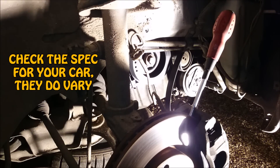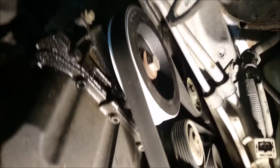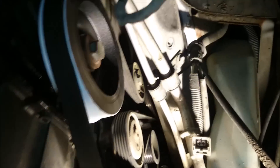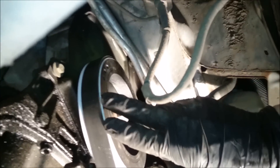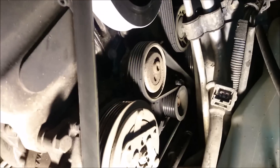All we need to do now is replace the belt. We used our 15mm spanner up there, rotated clockwise on the spanner, which moves the tensioner anti-clockwise, and put our belt on. You've got to make sure the ribs are all in place. When you let the tensioner move off the pulleys, check from above and make sure we're all in line — the belt's not kicking off to one side or the other. Then take it out of gear and start the engine.